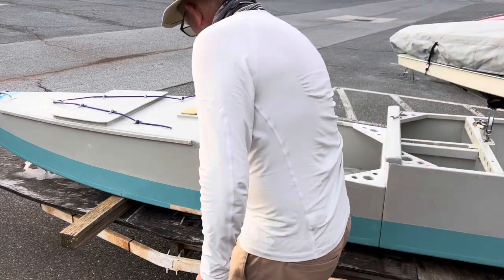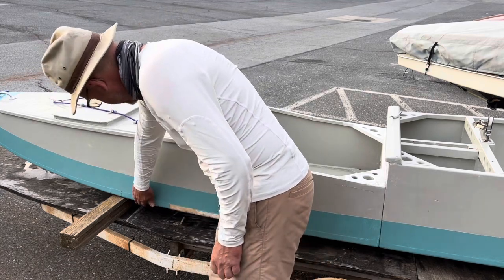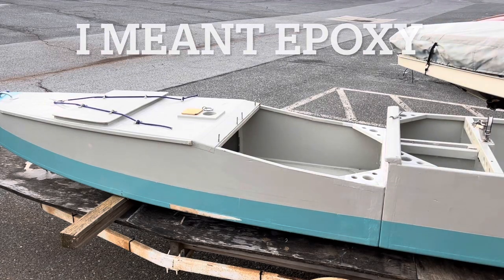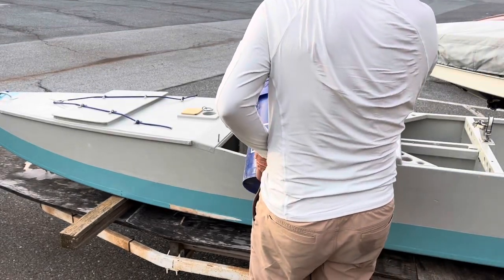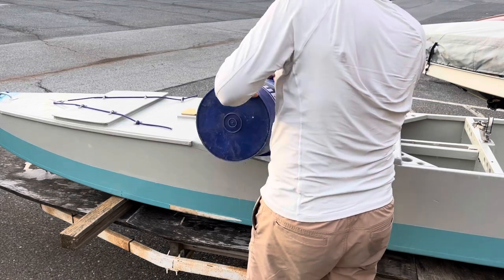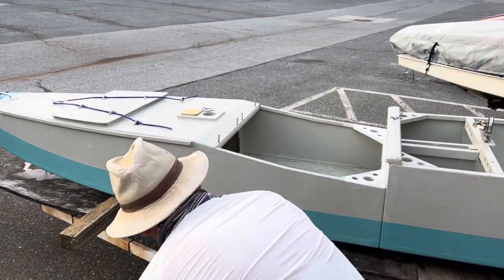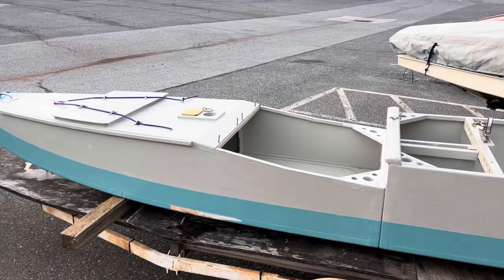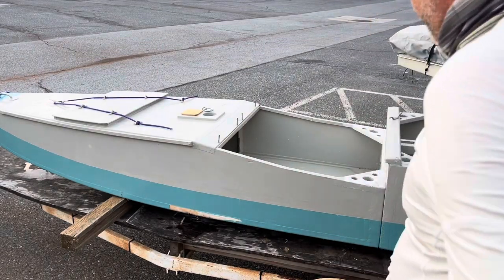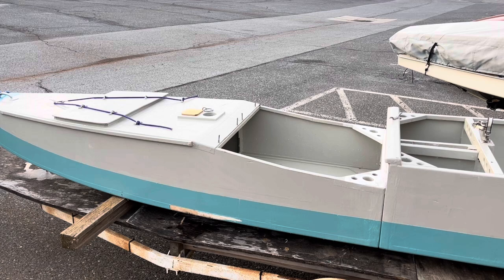Trying to find the leak. This area — the paper was wet so I peeled it off. All of this had a layer of fiberglass on it, but maybe the fiberglass right there was really thin. I'm just going to fill this with five gallons and see what happens. Yep, there's a leak. So that explains why the boat was sluggish today. It had about 15 gallons of water in the front when I got back to the dock — 15 times 8, it's like having an extra person sitting on the front of the boat.